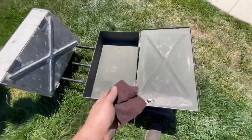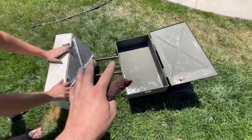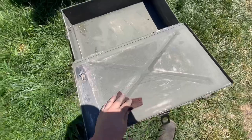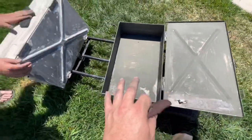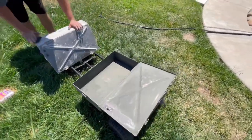Everything's ready for paint. He's degreasing it and scuffing up the paint so the new paint has something to stick to. I'm not really stressing on going to bare metal with these - just something scuffed up to where we can get some good paint sticking to these that'll last a while, and then we'll start painting.